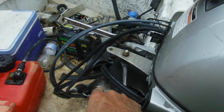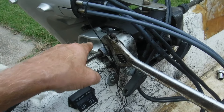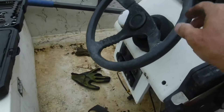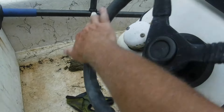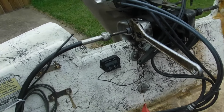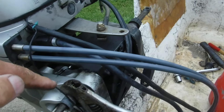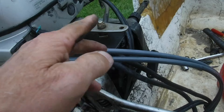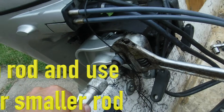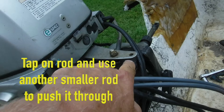It's definitely going to be inside this tube right here. We've got that loose and we started to pull it back a little bit. Here I've got my steering wheel — it's loose now, it moves. Watch what's happening: the wheel is actually moving here, but it's not moving the rod inside — this is jammed in here. So we've got to get this all the way out, clean this rod, clean this cavity, and it's going to be fine. The steering wheel is moving just fine — all the problem is right in the tube.